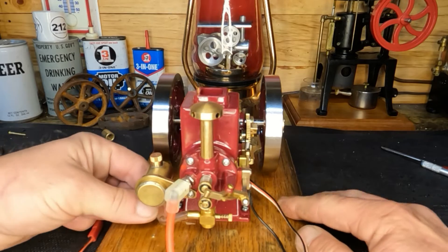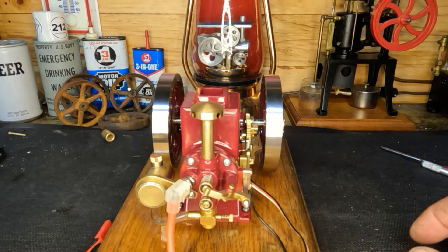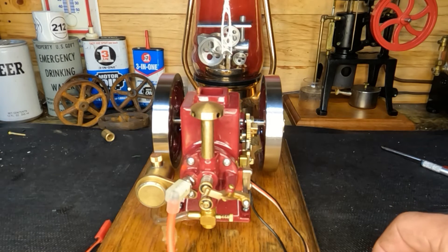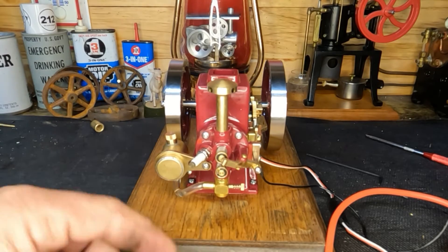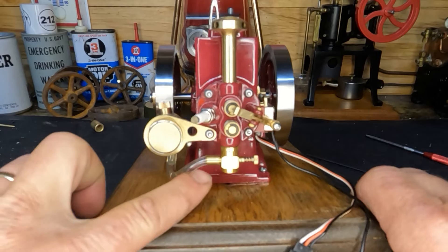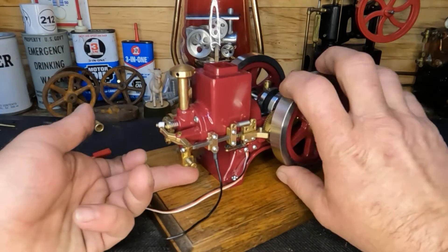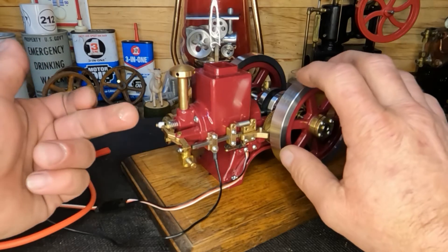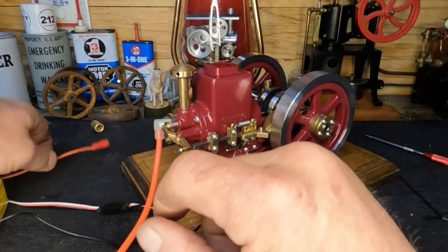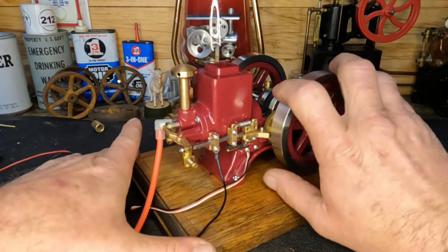What's leaking? Our fuel line's leaking. Okay, yeah, we're gonna have to address that. We've got our fuel line fixed — I just replaced it. You can see we don't have our fuel drawn up into our carburetor yet. We'll put our finger over the choke and prime it a couple times — I've seen it draw fuel up instantly. Put our plug wire back on, hook up our battery, we'll see what this thing starts like cold, then we're going to dig into that governor.